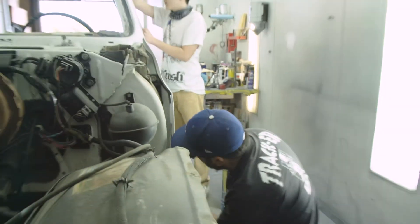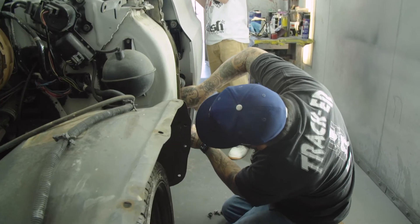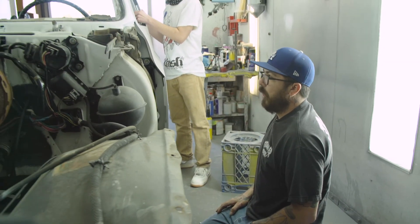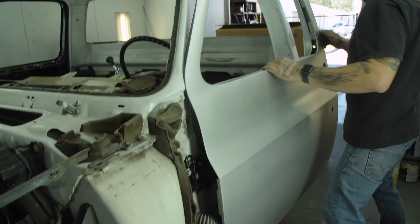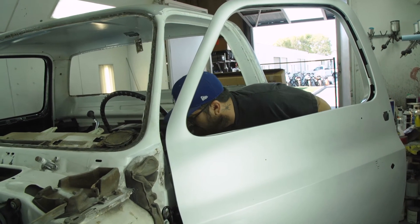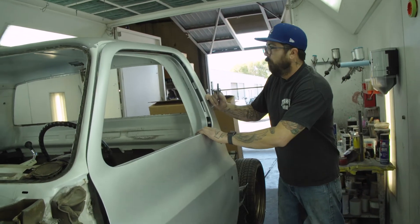How important is the weather stripping as far as the fit? Well, the weather stripping should be in as well, but you can get pretty close without it. How's it look in the back? It's actually pulled a little forward. Which is good — you can just slide the hinges back. That's exactly what I'm going to do. I'm just going to drop the hinges just a little bit.